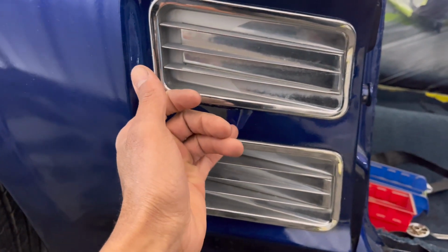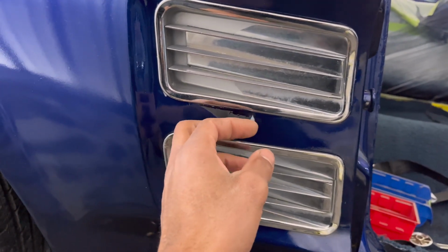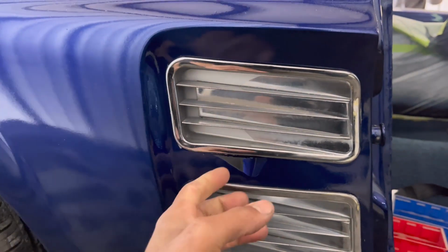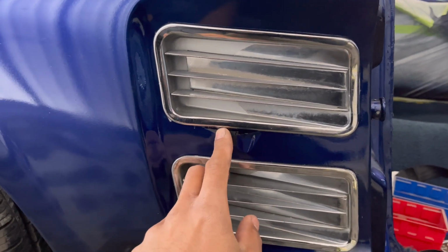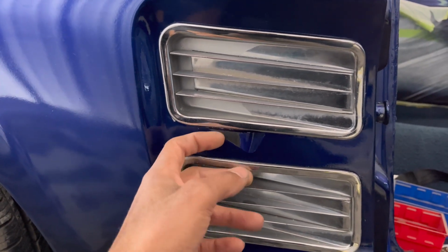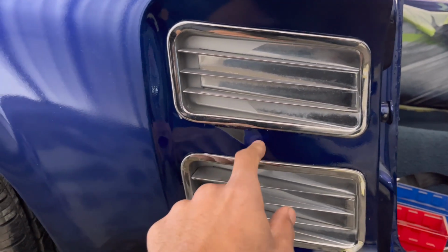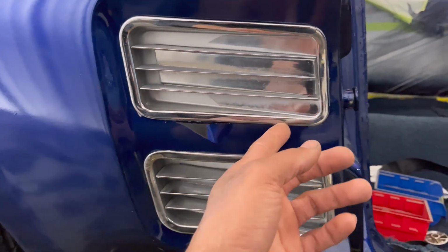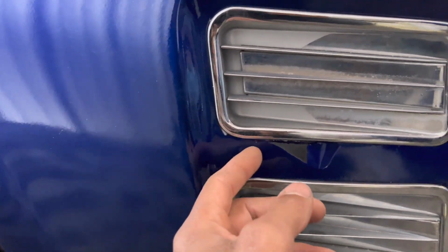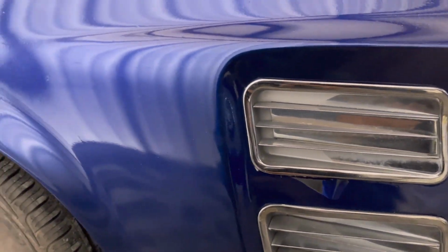Now what this just means is, one, 9 times out of 10 it didn't get sanded good enough. It has to have that grip. It needs some grip. And two is just the masking tape. The masking tape probably sat underneath what we were painting. So this is why it's very critical that you make sure that your masking tape is not on the paint job, or you know what I'm saying. So if you go too far over, you'll miss the area. And if you're not enough, you'll have paint on this chrome. So not a big deal. We'll get it fixed. We gotta sand it down anyways.